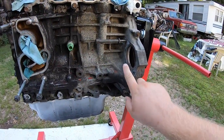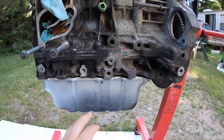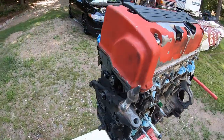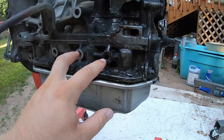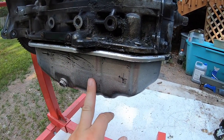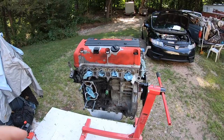For starters, you're gonna use your Z3 starter — I used mine, I didn't mess with any K24 ones. This is the steel oil pan off the K24A. You have to use your Z3 one because this one has no rear mount brackets. The rear mount for the Z3 went in here, and the K24s don't have any bolts for the rear mount. So if you're gonna be using your rear mount, which I highly advise, you need to use your Z3 aluminum oil pan.